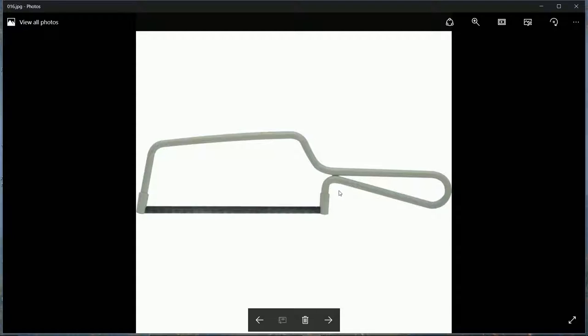A hacksaw is really important. Hacksaw blades are very cheap - about two pounds for 20 of them. A nice thin simple one costs about £2.99. You'll find a hacksaw very useful when, say, you're taking out a lower ball joint or track rod end and it's stuck - sometimes you just have to saw it off.